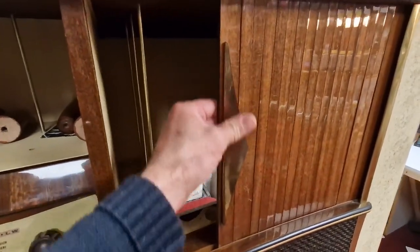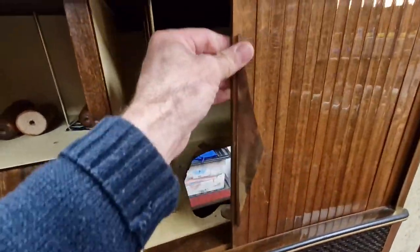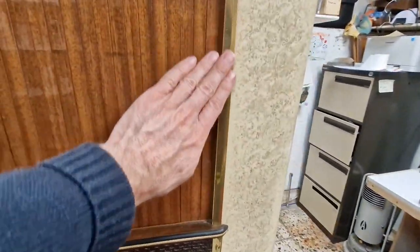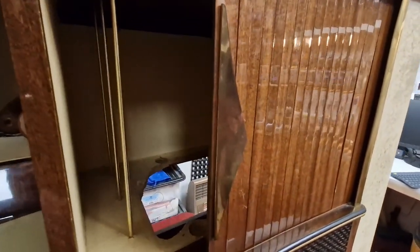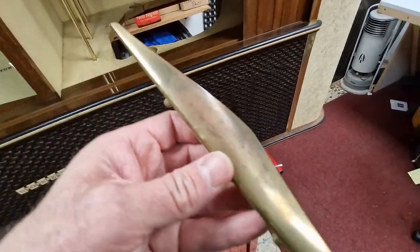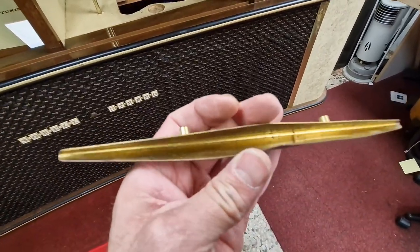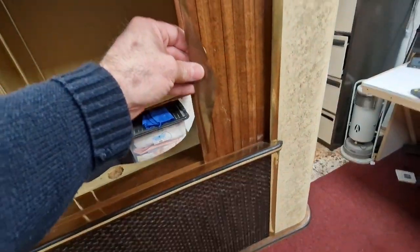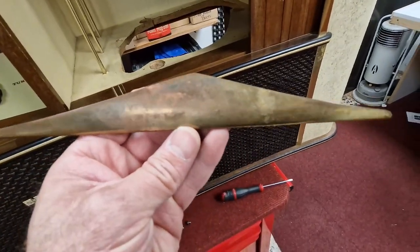Just one thing before I put the deck back in — these handles have really tarnished badly. Obviously they didn't have a massive amount of lacquer on from the factory, so they should be nice and bright and brassy like all the other bright work on the radiogram, but they're both a really browny colour and horrible. So what I'm going to do is take these off, put them on the polishing wheel, bring them all up nice and shiny again, and then give them a coat of lacquer. All being well they should do another 50 years. It's going to be really tricky — obviously I can't get the wheel into the recessed part, but you're not going to see that bit. This front visible part is what I'm going to re-polish up.